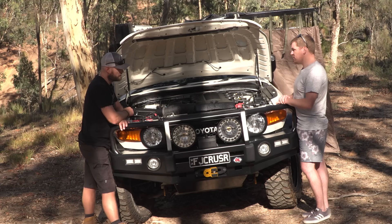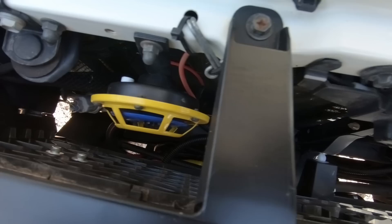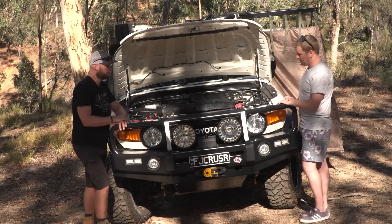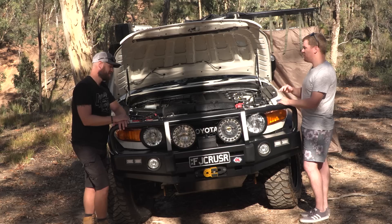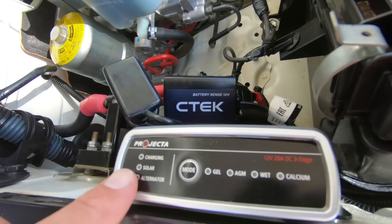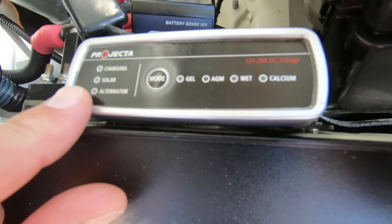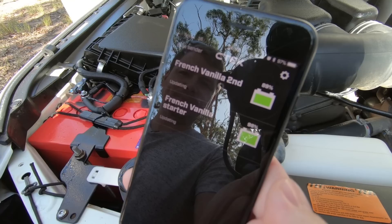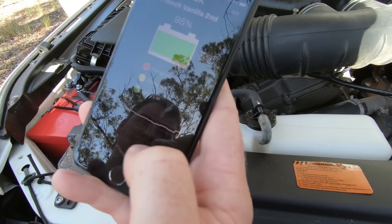Your horns are a bit yellow. They're just the Hella dual-tone horns — my front horn went a bit average from dust, mud, or water, so I just changed them out. It's a charging system here — an IDC DC-DC charger, 25 amp. Solar input as well? Yeah, that Anderson plug beside it is for the solar. I've got a C-Tech battery sense on both batteries — Bluetooth to your phone. It tells you the voltage and that the battery's in good shape. That's probably the most you really need anyway.